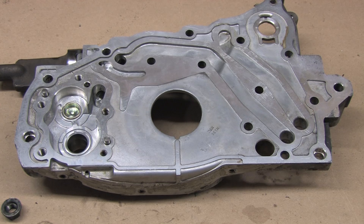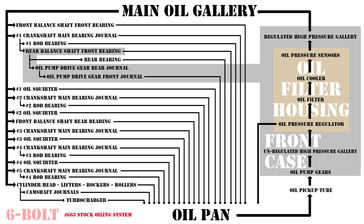This happened to me with my oil pump because of my stub shaft selection. I've got a set of diagrams representing the different models of 4G63s and where the oil flows. Everything for a 1G seven-bolt is exactly the same as the six-bolt oil system chart. This shows the oil path through the engine which runs as a cycle — starting at 6 o'clock as if firing up a cold engine. The gray rectangle is the front case, the tan rectangle is the oil filter housing. The 12 fat arrows protruding from the main gallery line are the primary oil galleries tapped into the main gallery in order of flow, and secondary galleries branch off of half of these oiled components to supply other parts downstream.